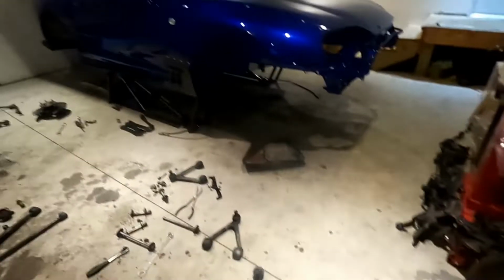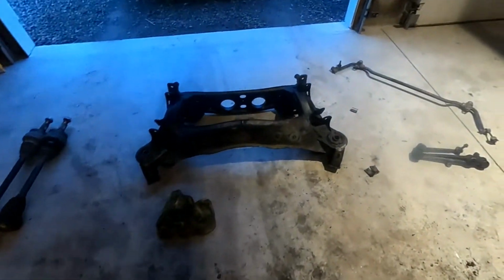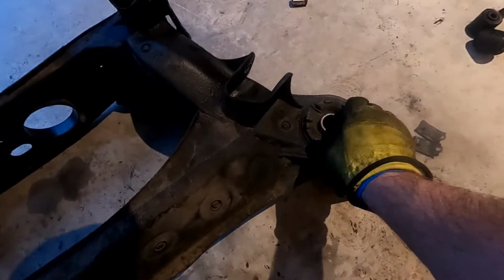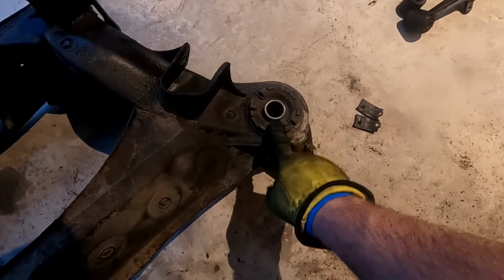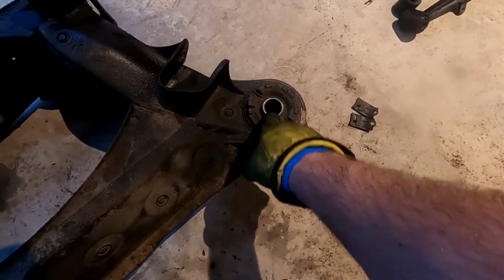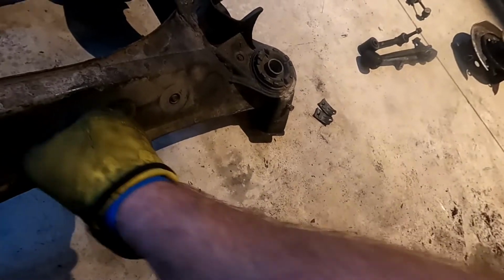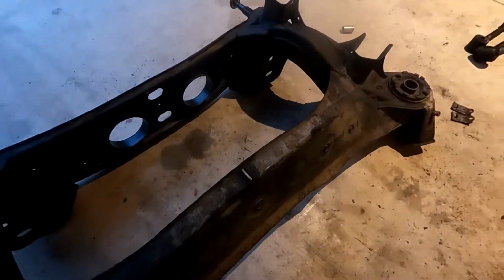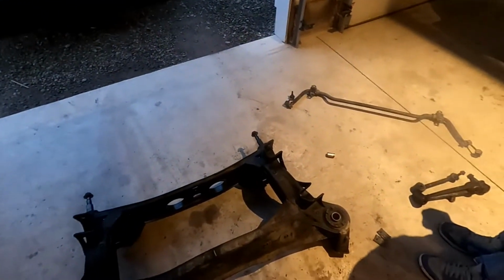We'll be back. All right, guys, so as you can see, everything has been disassembled. There's freaking parts everywhere. We got the subframe all taken apart. These aren't coming out because there's supplemental ones, and we did not get the ones that are direct replacement. There's just supplemental washers that go in here. To be fair, I tried. Nobody has them. It's not my fault. We do need to pop out these little plastic things everywhere. They're little drains, so those all need to come out.